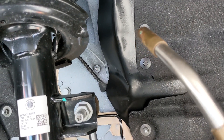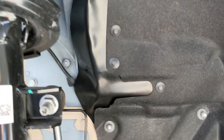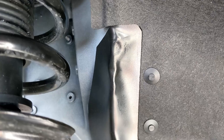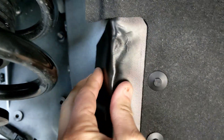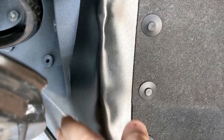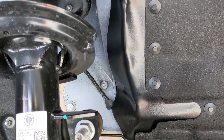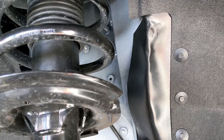What I'm doing now is just barely heating this up. You can see how it just barely folded over there — I'm going to pinch this into the contour that I want. I'm not really melting this; you could probably use a hair dryer. Just be cautious if you do use a torch like I'm doing. You gradually contour this around the stuff there — it should be fairly easy. Just gradually work from one side to the other.